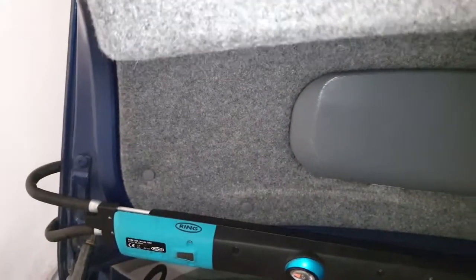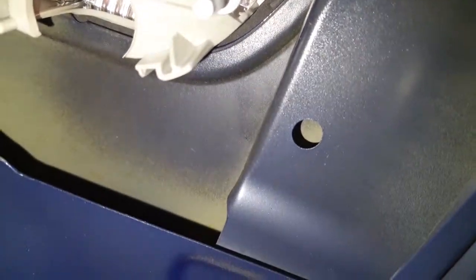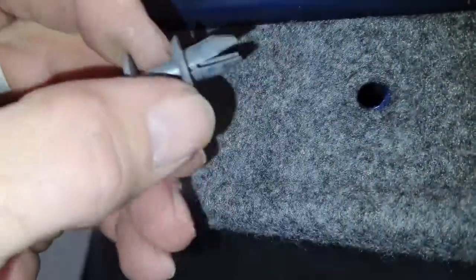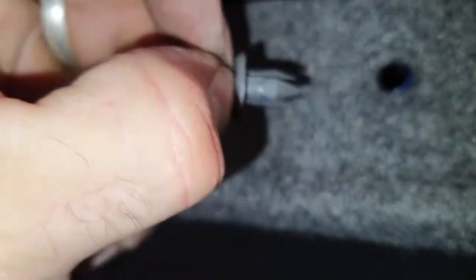You can see where the new bracket goes — looking underneath you can see the metal lip where the bracket has to go. That puts pressure on it and holds it in place. Put your bulb cluster back in, then put your rivets back — they should push fit quite easily. You might have to slide it forward or use a screwdriver so it pinches the ends together, then just push it in place.